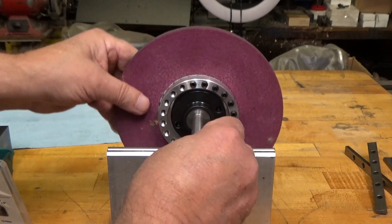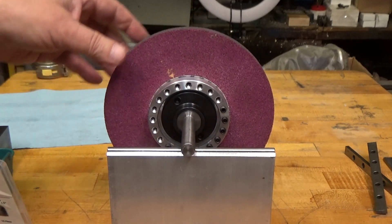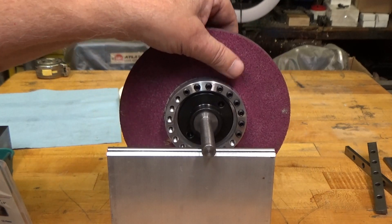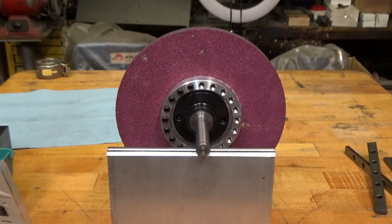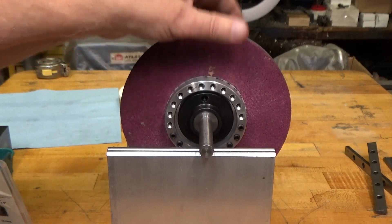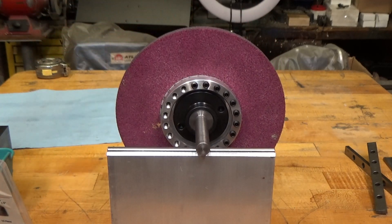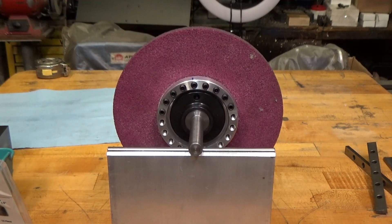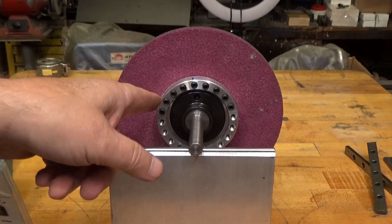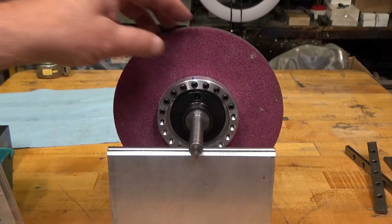You can see if I set it — it's pretty well balanced and it's not moving now. That's got it pretty good. It's about as close as I think I'm ever going to get it. I ended up with set screws all the way around one side in order to balance it. That was a new hub, so I suspect it's the wheel not the hub — which is good.